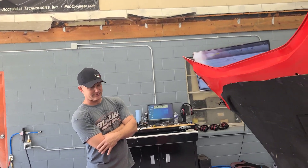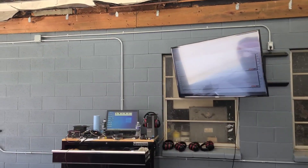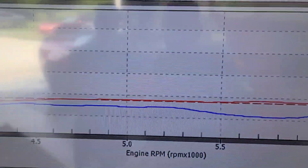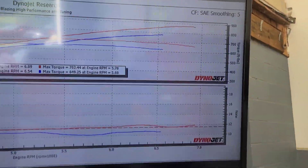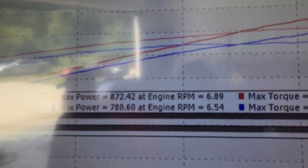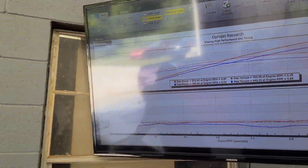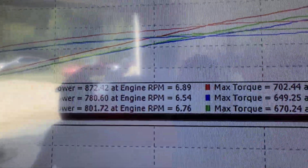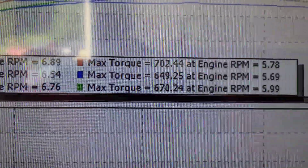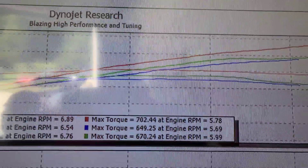So it came in pretty solid. The tune was a little fat. Had a decent amount of timing in it — I was pretty happy with the timing. But it came in a little fat. We were able to lean it out and get the fuel back in check. This is like the last run we did. Cooled off. So it's not exactly where it would be. This is probably going home with 840–850 tune. And 801 was filter on. So we picked up about 20 horsepower with tuning and about 20-plus foot-pounds in the mid-range.